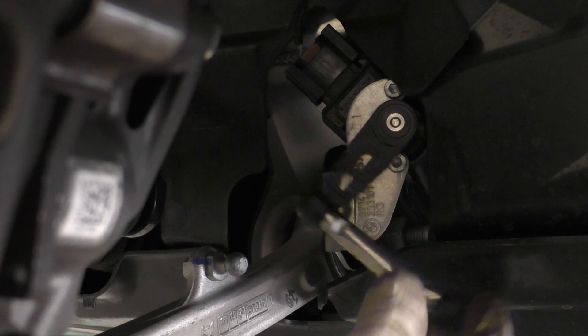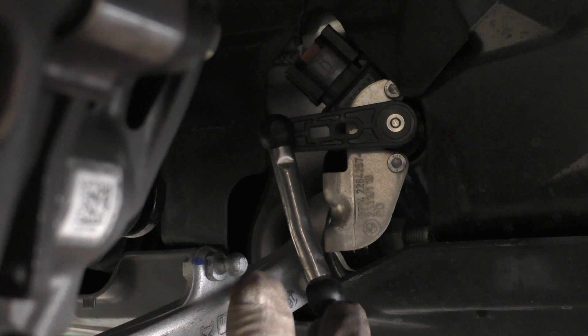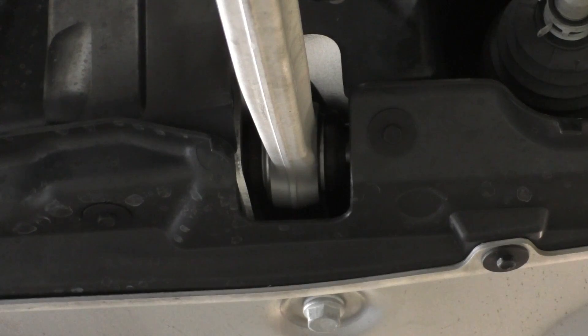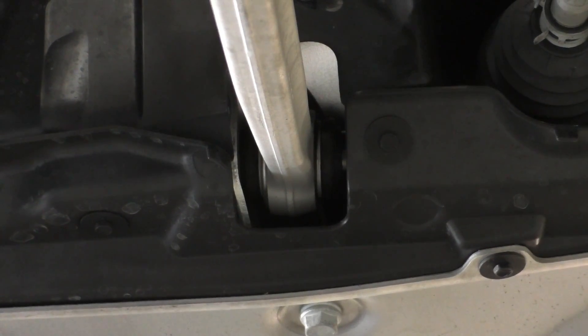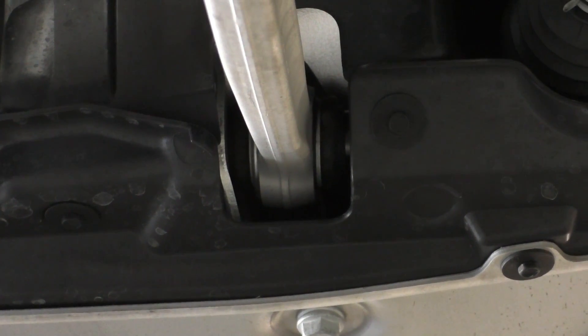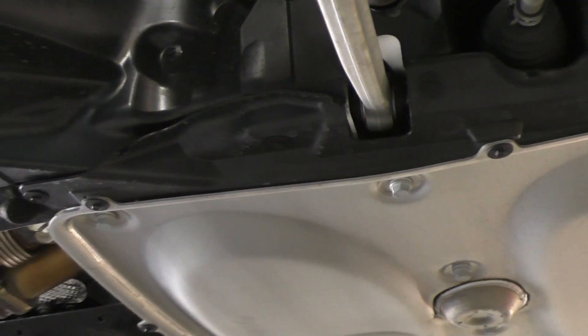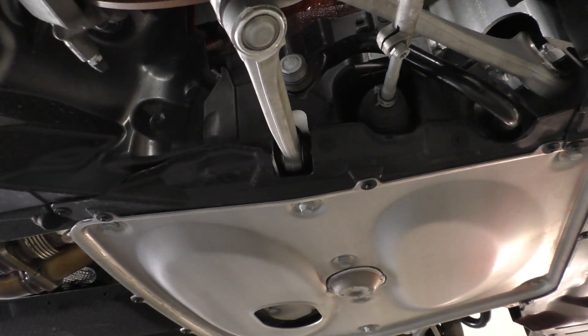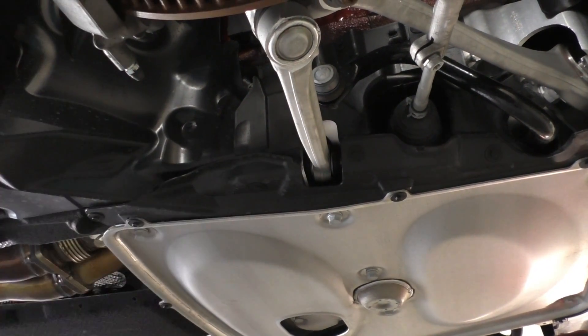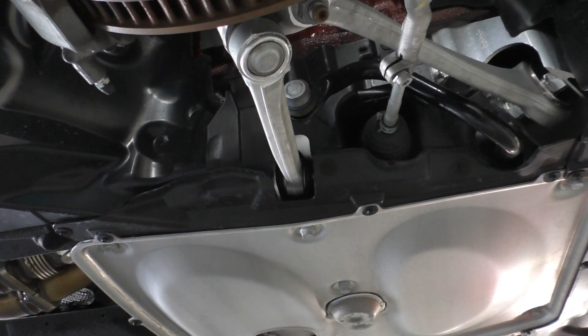Remember to take note that this arm up here is facing towards the front of the car, so when you reattach it later you'll have it in the right orientation. Next, if we look at the arm and zoom out a bit, you can see we can't access the bolt holding this, but if you look up on the right there's an 8mm screw — there are a number of these from the very front going back that we'll have to remove. That will release this cover piece and allow us to see the bolt holes. I'm going to go ahead and remove all of those 8mm screws to pull that part out.